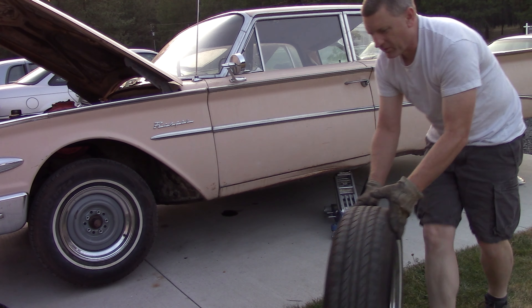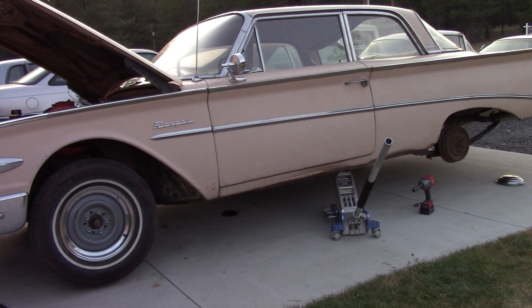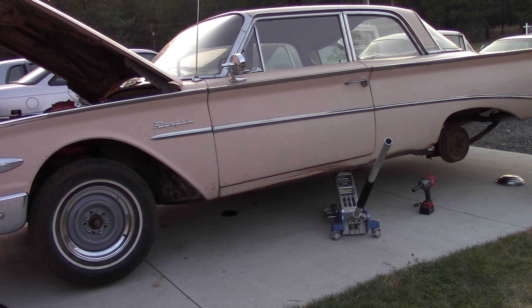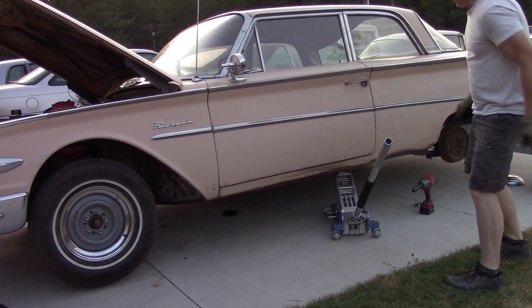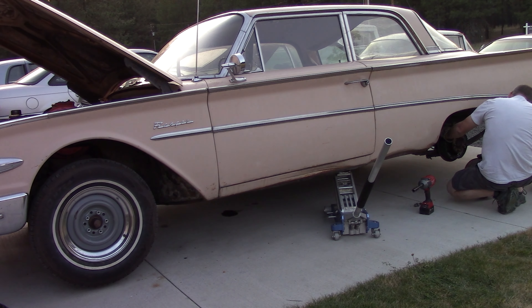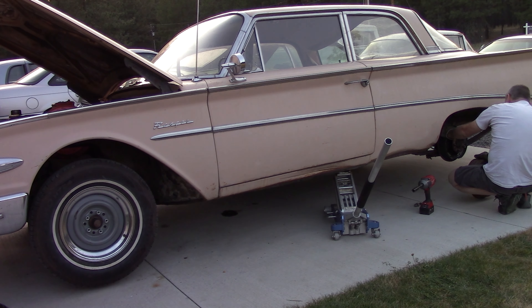Off with the Optimo H724. Decent tires, but by the looks of them, a dog peed on them a lot. The first thing we need to do is check that brake — the drum comes right off. We've got another set of backward shoes, and it looks like somebody put new brakes on this side — put one new spring on — but again, didn't know that the bigger shoe goes on the rear.